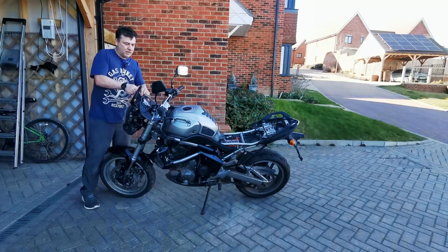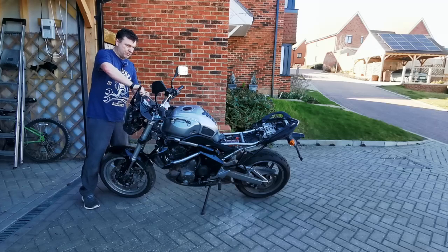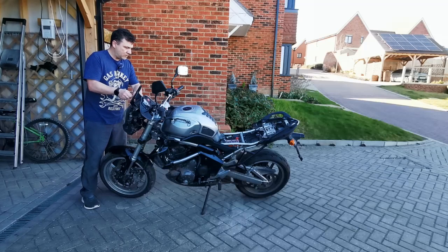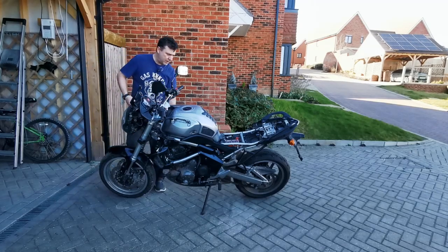Yeah, not easier. So I'm now thinking with that ignition, if I am lucky, they've cut it this side of the ignition, which I'm hoping they have, which means I will have the block to connect into, which would be a nice easy fix. Now, I've had a quick look on eBay, and these aren't massively expensive, especially for a second-hand one, and it doesn't look like at this stage that the ignition is coded. So we're going to have to just see, aren't we?